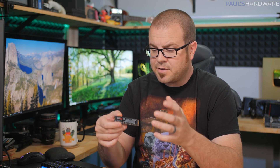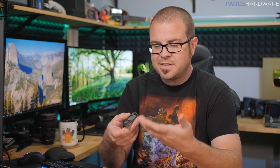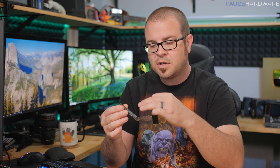Consider how you'll be using your M.2 drive. If it's just an OS drive in a gaming PC, it won't get heavy sustained write loads. If you're doing video editing, it might get hot over time. Also, you don't necessarily want to cool everything on the SSD. The controller — which looks different from the other chips — you want to keep cool. The other chips are NAND flash. NAND actually likes to be warmer while being written to, and cooler when idle.